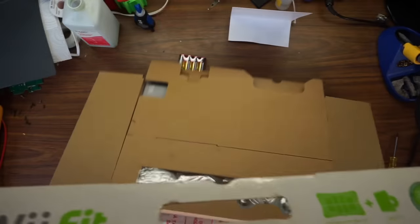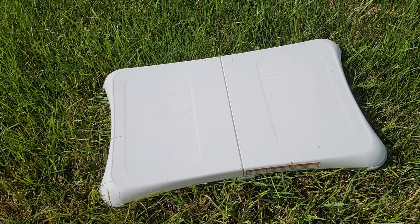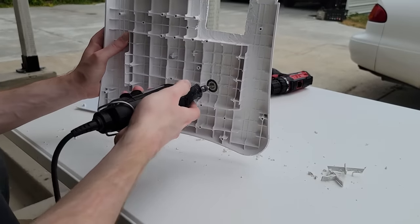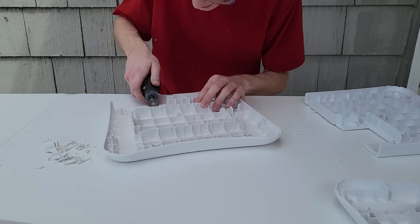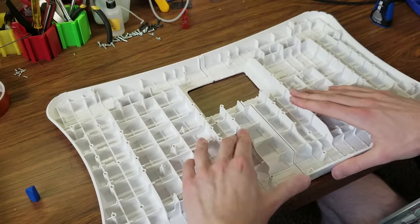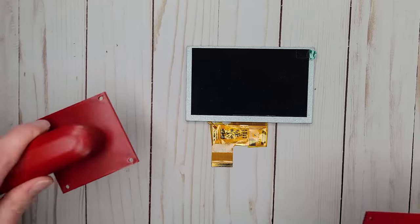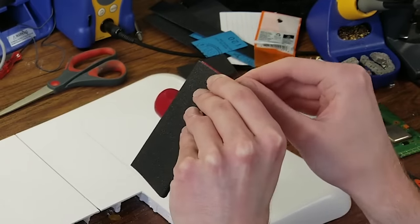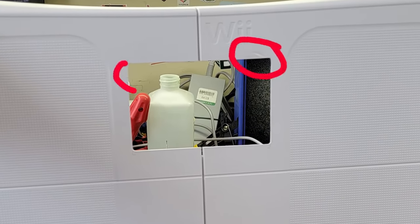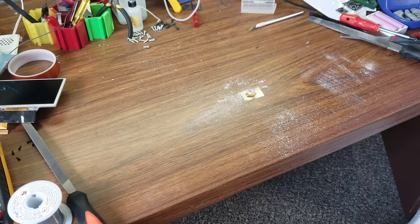That's a surprisingly cheap price for an unopened video game accessory from 15 years ago. Now that I have this thing in my hands, I am starting to reconsider whether I should destroy it — it's in such immaculate condition and it just looks so clean. Just kidding, I'm crazy! Cutting through the board did take quite a while because you have to clear out all this lattice work before you can actually cut the final hole. After inhaling enough plastic dust to become an honorary sea turtle, I'm left with these pretty rough looking halves. I've opted to super glue the two halves together and used 3D-printed sanding paddles designed to be nearly the exact length of the screen hole, so I can evenly sand across an entire wall at the same time. At the end of the sanding process, I'm left with a screen hole that looks pretty good overall, with some minor flaws here and there.